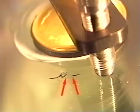Viewing stars and cracks head on, you will see a distinct line when filled. Look at the repair from different angles. If it disappears, it is filled. No black should remain.